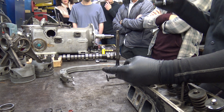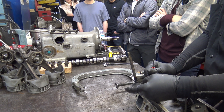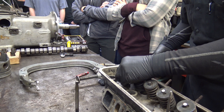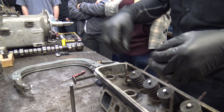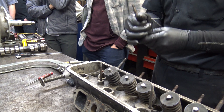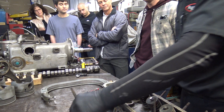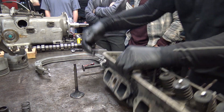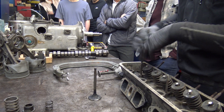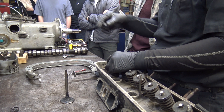Typically when you do a compression check and you've got a cylinder that's very low on compression, you either have some junk under the valve, the valve's bent, or the seat's cocked. This is called a valve guide — it's got a tapered top on it, and it has a seal in here. Normally it's a rope — this waxy rope that sits on there — and then this little hat here goes over it, squeezing to keep the oil from going by. There's negative pressure here, so it's sucking oil in when the piston comes down and the intake valve is open. Exhaust valves don't typically have that problem.